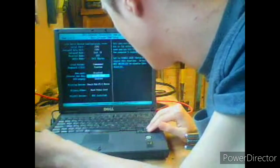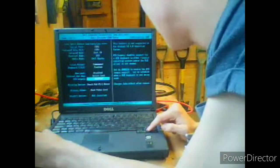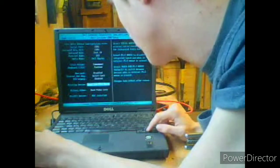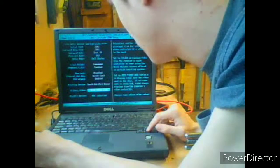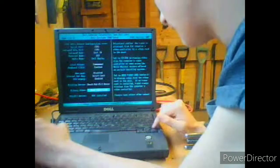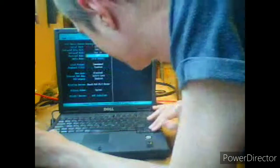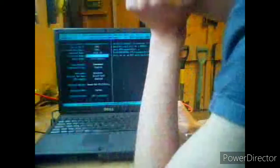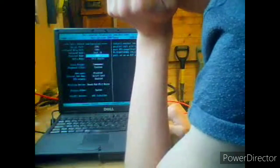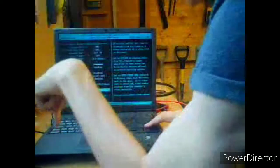Alrighty. Scroll lock on boot. It's a USB legacy. Well, scroll lock doesn't come on immediately the thing comes on. Pointing device. Yes. Dock video card. Primary video device. Well, like, HDMI RAID, can I change that? System. Yes. No, I want parallel mode, normal, bidirectional, ECP. Disable. I think it said ECP, I'm not sure. I'll have to look back at the footage and change it. Okay. No. Mini PCI device isn't installed, but I can't change it because there isn't one installed.